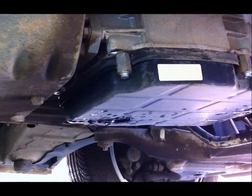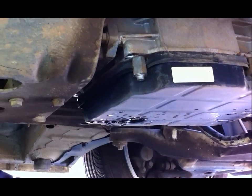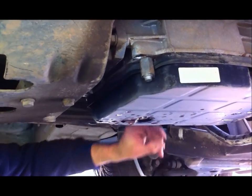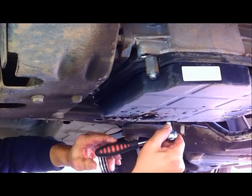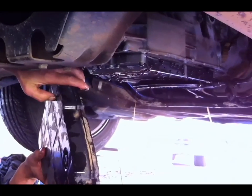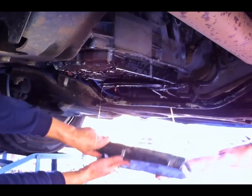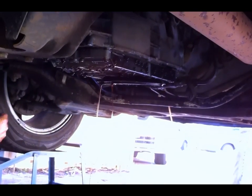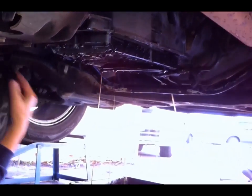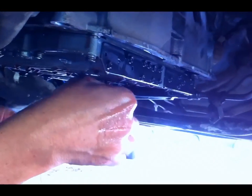What we're up to here is we're taking the bolts out of the oil pan. We had a few problems because some of them were very tight, which is not unusual apparently, and we actually broke one of our Torx bits. But we persevered and we got them out in the end without breaking any of the bolts. One of the other Stooges has taken the oil pan away to give it a good clean. So you need to get the degreaser onto it and thoroughly clean the oil pan so that you can eat your breakfast off it. Again, cleanliness is very important, and use lint-free cloth or rags.